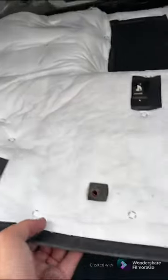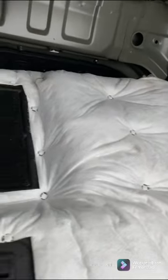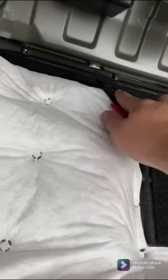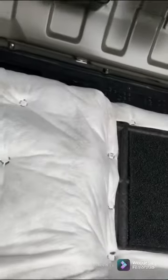So as it turns out, I'm trying to take this entire headliner out, but you see the back side of those bolts, that's bolted from the inside. You'd have to pull the seat out to loosen that, and this is pinched between there, so I don't think this is coming out. So I'm going to try to do this without taking all that out. There's a lot of extra work. Also, there's some clips. There's a white one right there, white one right there. I'm going to pull those out, reinstall those into those slots, so that when we reinstall this, that stays up.